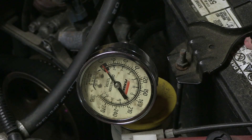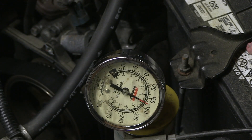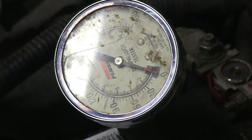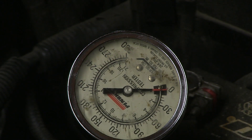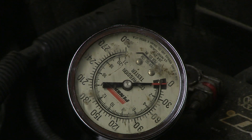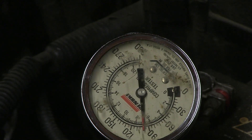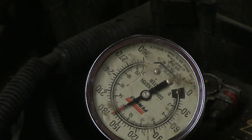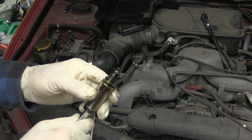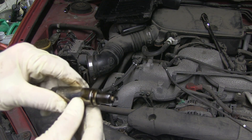The battery is almost dead. So this is cylinder 4 — here we go — cylinder 4 coming right out. Right now in this case, the spark plug is wet, the threads are wet, and the electrode tip is wet.